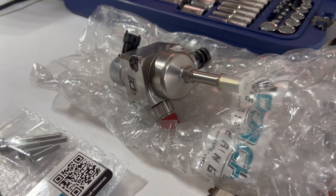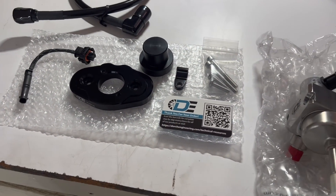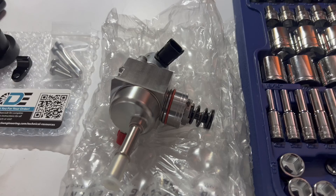You can also check out my previous video on the install of the Stage 2 pump if you're looking to DIY this job — it's really not that hard, you just have to stay clean and avoid any contaminants in the fueling system. The Stage 1 is a great option if you're staying on a stock turbo setup and can safely push north of 550 to 600 wheel horsepower. But if you're looking for more, move on to the Stage 2 fuel pump, and with that you can also upgrade your turbo and really have room to grow. Alright guys, that's going to wrap it up — hope you enjoyed my review of the Stage 2 Plus tune. Be sure to like, subscribe, and I'll catch you all in the next one.